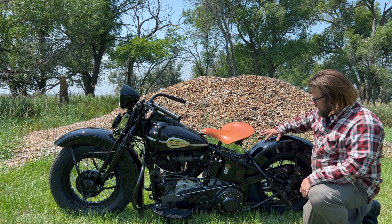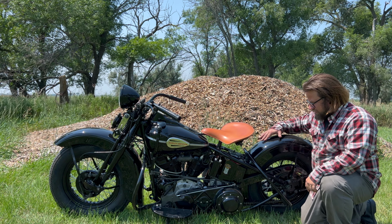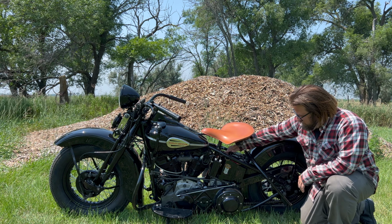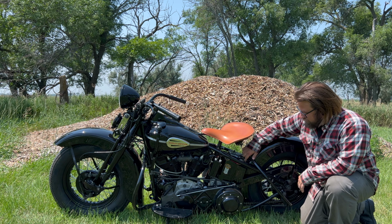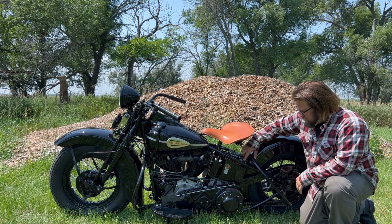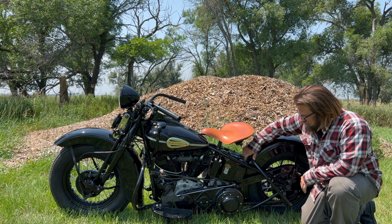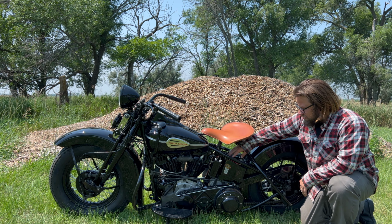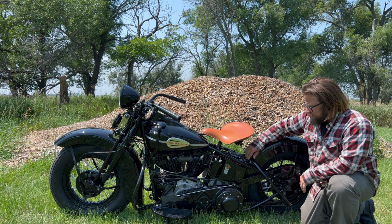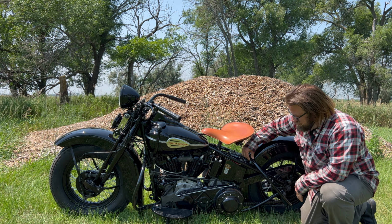These 3 screws are for a buddy seat clip. These are in every stock fender. The dipstick is Parkerized. The wiring flags are the copper flags that came out in mid-39 and were used through 45. This has a NOS wiring harness. It's all the cloth on copper wire instead of the cloth on rubber on copper wire. It's as cool as it gets.